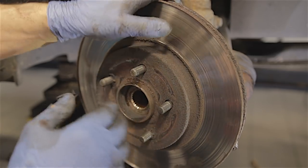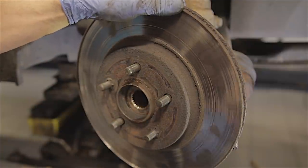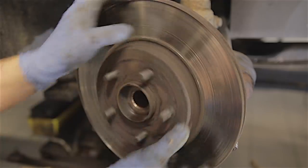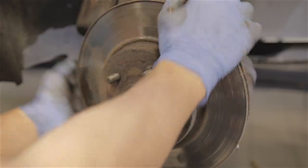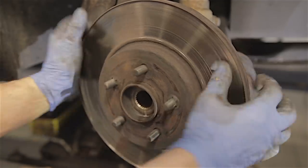I won't have to bother about doing the driveshaft bearing now - I'm pretty sure this is what it is. This car has only done 112,000 miles so it's not really that high mileage, but I can feel the roughness in that bearing on the disc, so it is definitely a bearing.